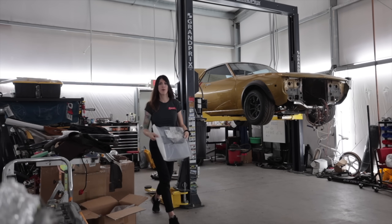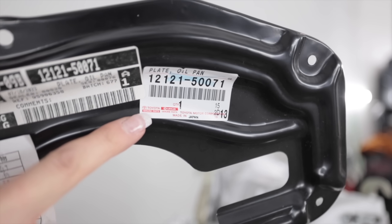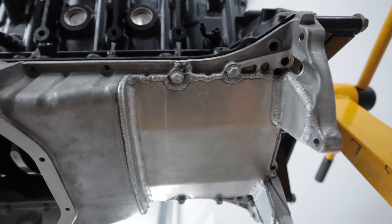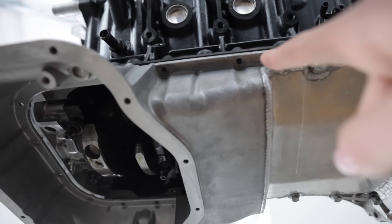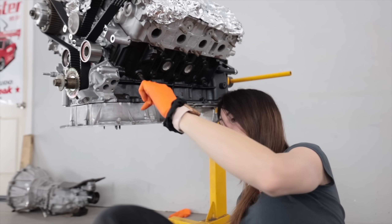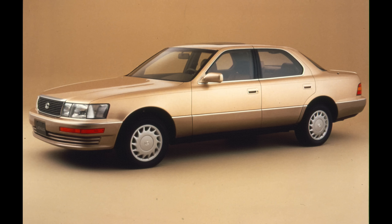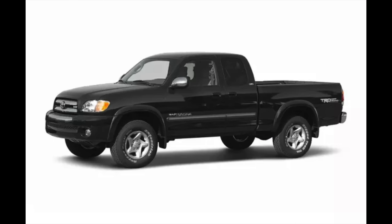This right here is a genuine Toyota part — you could argue it's a genuine Lexus part. Oil pan, water pump, timing cover, valve covers. The eight bolts that go in the rear of the oil pan are the same between a 1UZ and a 2UZ. However, these right here on the 1UZ pan, as well as these ones up inside by the sump, are exactly one size smaller — like an M6 versus an M8. The bed plate and oil pan on this engine are from a Lexus LS 400 because it's front sump, so I have to use a mixture of hardware from an LS 400 and the Tundra to make this oil pan work.